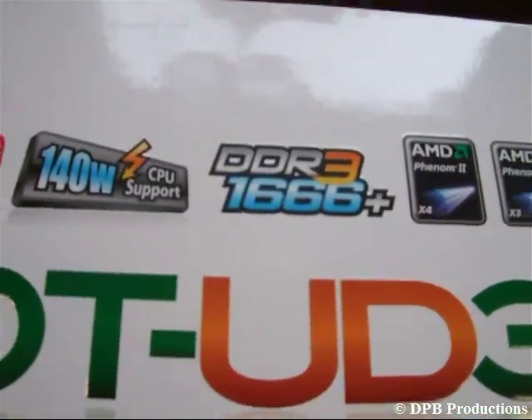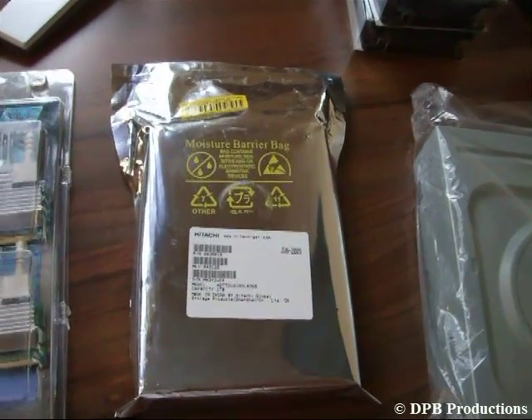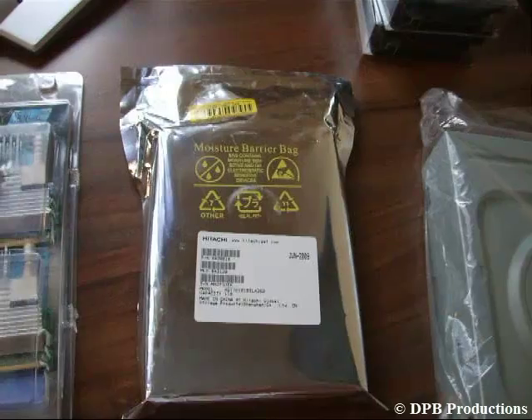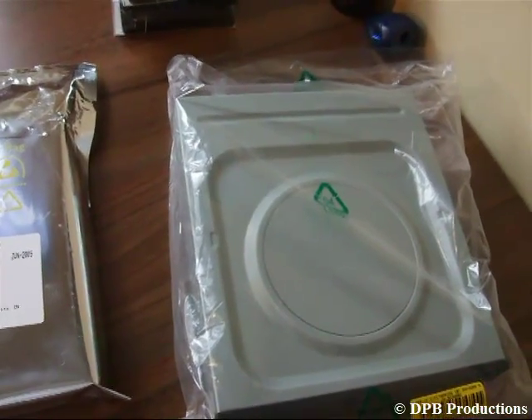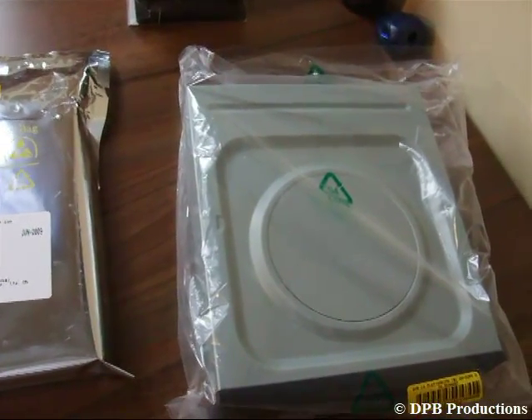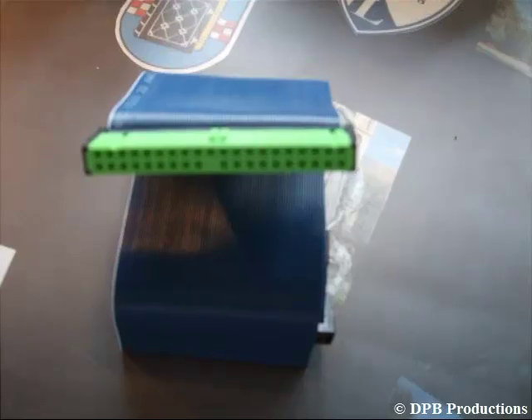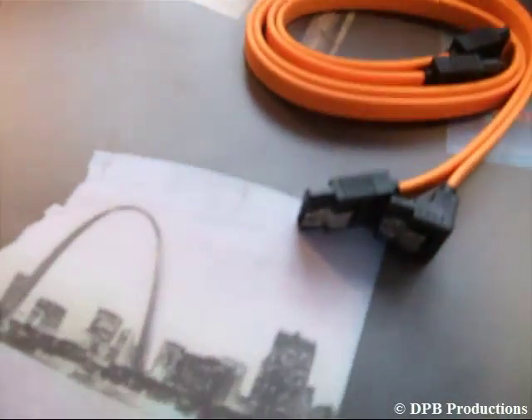There it is. If you don't have a SATA hard disk you need to buy another one, because most modern mainboards do not support IDE hard disks. Also make sure that your DVD drive has a SATA connection, otherwise you have to buy a new one too. This is how an IDE connector looks like, and in comparison this is a SATA connector.